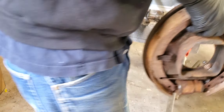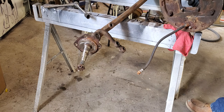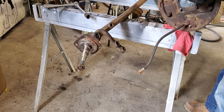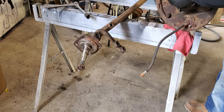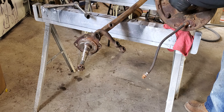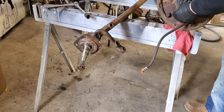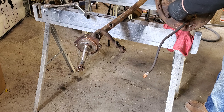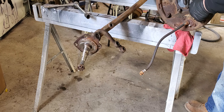There's one side. I'm going to put all my bolts back in, put the nuts on them, so that way you know where they are. When things start getting laid down on the bench, next thing you know you're asking what goes where. For me personally, I just find this an easier organizational process. As I work on each hub separately, I'll take it apart, put all these parts aside, finish one hub, and move on to the next one.